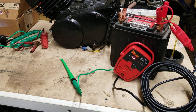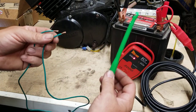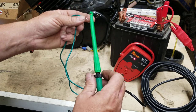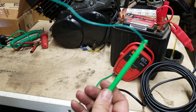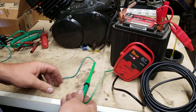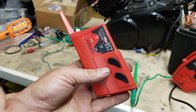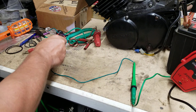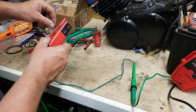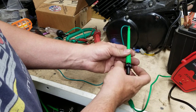Alright, I have the tone generator set up. I've got a wire here we're going to test. I take my probe and pinch it right onto the wire — it has different adapters so you can back-feed sensors or wires. I plug this in and it's on. Now I take my handy little wand, set it to low, and run it along the wire. You can see it has a tone all the way through — that wire is good. If you move it away, it beeps out, so you have to keep it close.